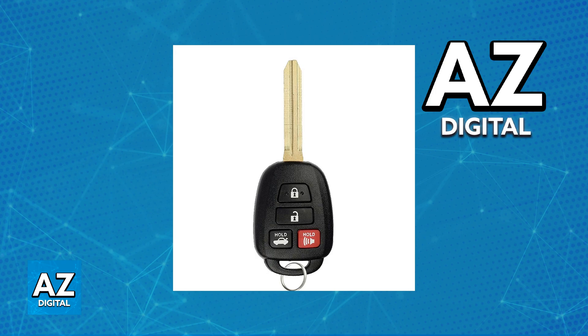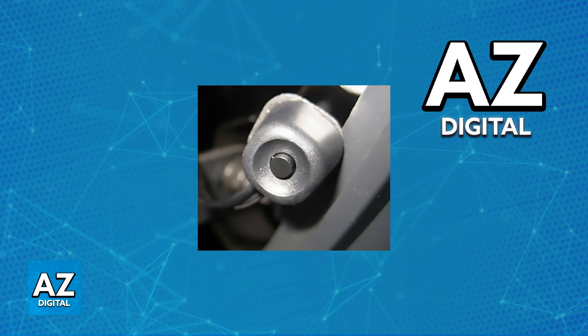Now, if it still doesn't work after you opened the door and you turned on the car, look for a hidden valet button. Some car alarms have a hidden button that can be disabled, and once you press this button, it is going to go away without using the key or the fob. The button is usually located near the fuse box, steering wheel column, or the driver's pedals. I highly recommend going over to your own specific car's manual for the location.